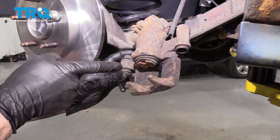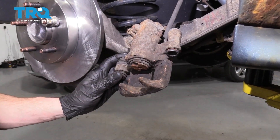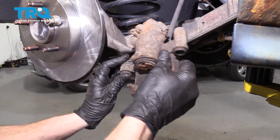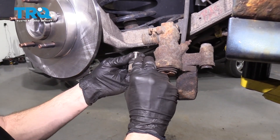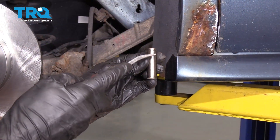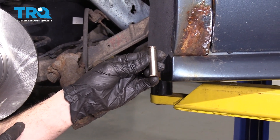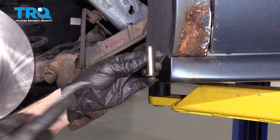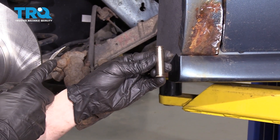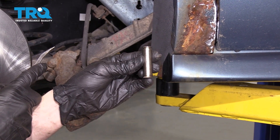Over at the car, we're going to start paying attention to the caliper, which is still connected with the flex hose and that e-brake cable. What we want to do is pull the slider right out of this area — pull down on the boot, press that slider pin up and through, and carefully remove it from the boot. Make sure the entire sliding area right here is clean and free of any debris, pitting, or any type of damage that might restrict it. Along each side of the slider pin you're going to find those same divots as we cleaned up before — make sure you clean those up so no moisture or debris can get in.